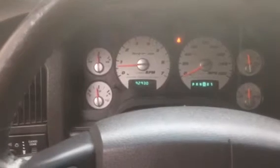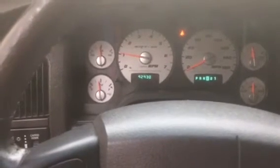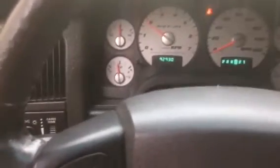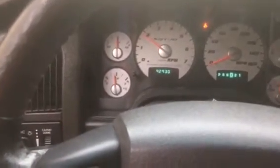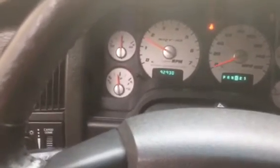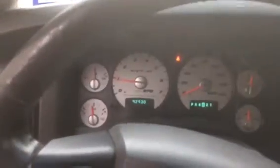Here's a quick example. It's at idle right now. Basically, you're going to notice when the wheels start to break loose is when it's finally reaching its mark. We're at 2,000 and it's not even spinning the wheels yet. About 2,200 it's starting to spin the wheels. In a flash situation though, if we're at the track and we just mash it, that's where it's going to get its 3,000 stall.